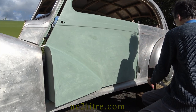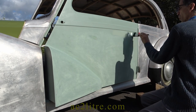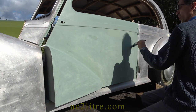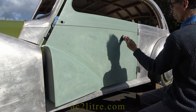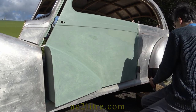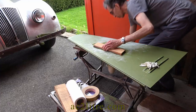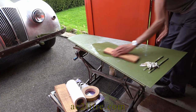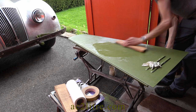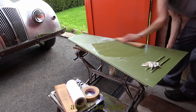This is where I was making some mistakes back in 2021. I applied it in warm weather, but even in cool weather this undercoat needs thinning. The result was very deep brush marks requiring some coarse sanding. If it goes on thinner and smoother I can rub it down with 280 grit followed by 400 grit. This is done mostly wet. The water makes it hard to see details on the paint surface so I do the finishing touches dry.